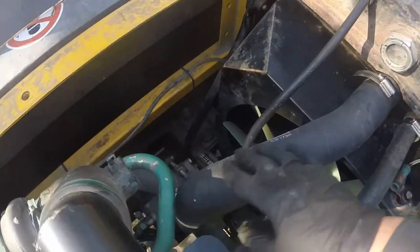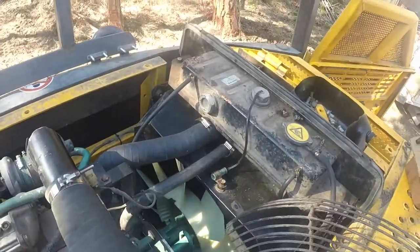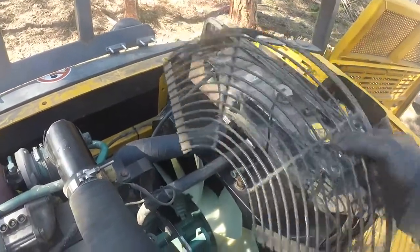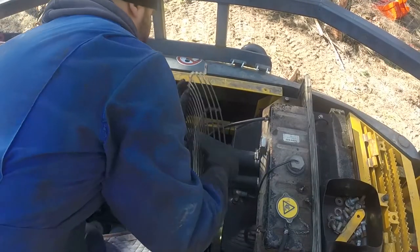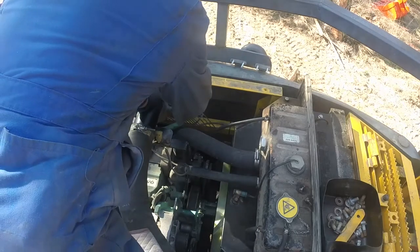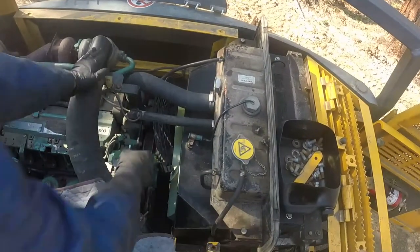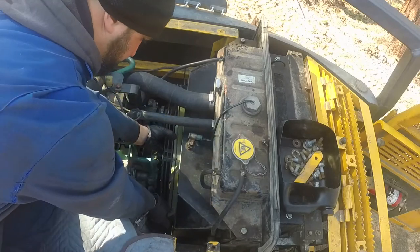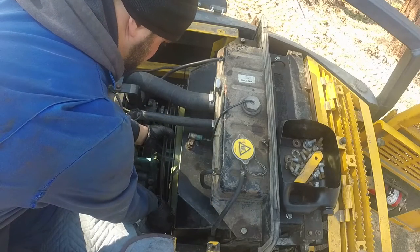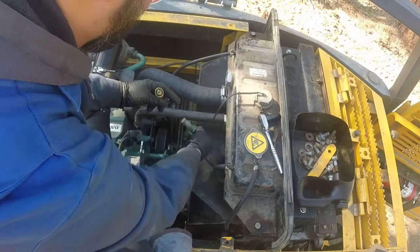Okay, I connected all hoses, the upper radiator hose brand new replaced, we had a cut in that, and the coolant level sensor will get in. A guard for the radiator fan is coming next. Only two 13 millimeter bolts on both sides. Assembly is kind of my favorite part, because as soon as you got everything apart, if you did it, you have that sequence in your head, how to get everything in reverse.